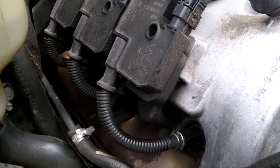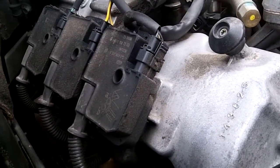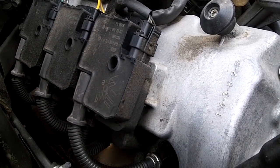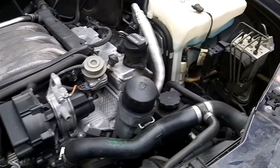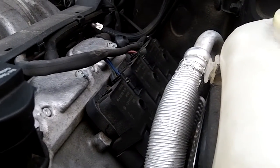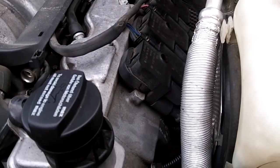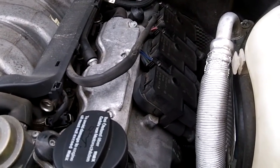It's going to be a little bit different for the S-Class S320 and the E320 — this is a CLK 320 — so there are going to be slightly different access problems on each one. On the CLK you do need to remove the air box to get to the plugs on this side. The other side is a little tighter on the driver's side, but you can still get to them. I've seen some people say you have to jack up the engine — I don't think you do, but we'll see.